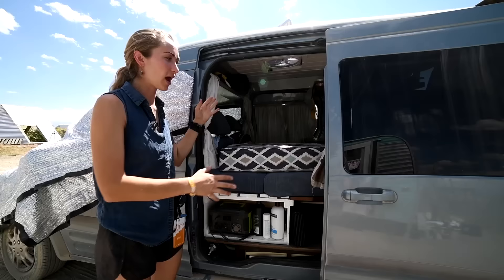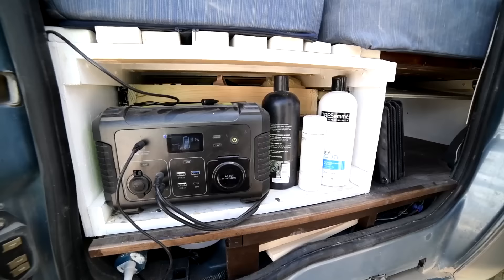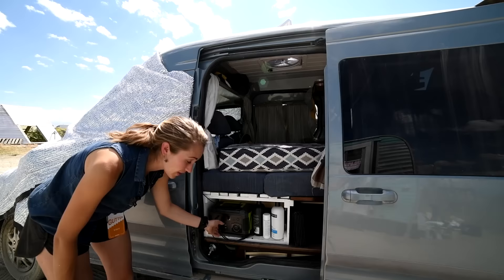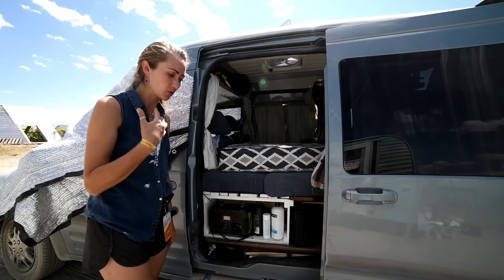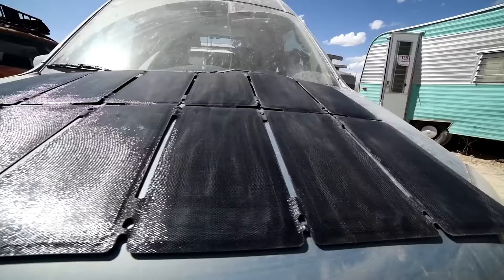Across from the other door, just beneath this bench here, I've got my Pax S power pack — it's a 300 watt-hour power bank. The really cool thing is it's got everything in one: I've got an AC out, lots of USB ports, and also a DC out. These plugs are going to my lights and my fan, and then this plug here is where you can charge it up. I either have that connected up to my alternator so when I drive it charges, or I pull this cable out here and I've got my solar panels that I'll pull out front on top of my hood whenever I park somewhere.